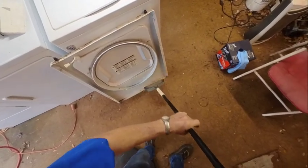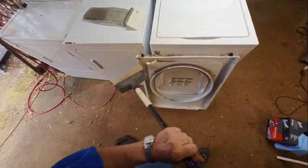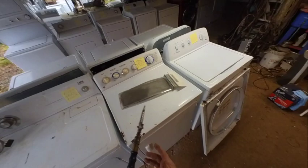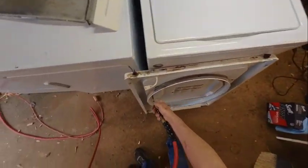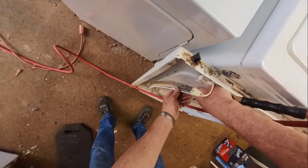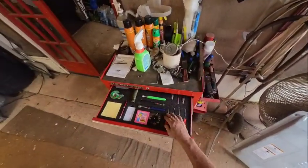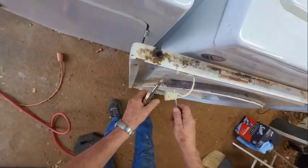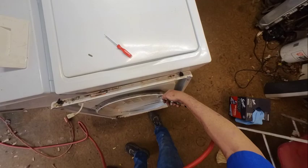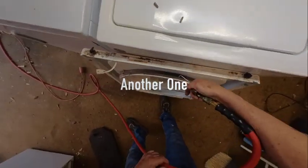At this point I was thinking I might scrap the front panel because of the screw holes in it, but it's in pretty good shape and the seals are nice. I'm thinking I can probably knock out those screw holes and put some Bondo on it. I cleaned up the felt seal with an air hose and there was something stuck in there that concerned me — it was stuck in there pretty tight. And your drum is riding right against that. I'm pretty sure they're rimfire cartridges — you have a rimfire cartridge stuck in the edge of the felt seal with the drum running over it all the time. And not only one, but there's one on the other side too.